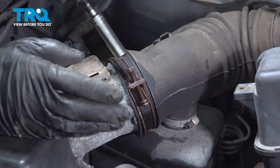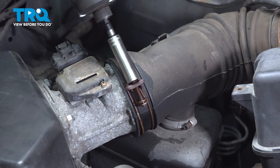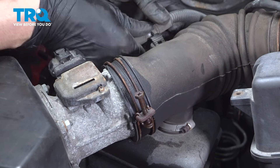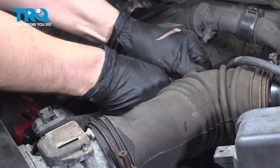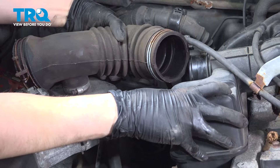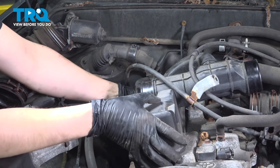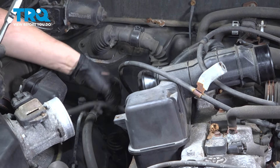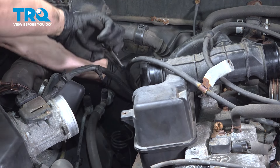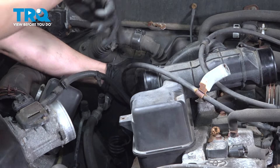In order to make a little bit of extra space, you can take this clamp off so you can pull the whole thing off at once. You may not have to, but I prefer to do this. Loosen it up, get this wire popped off of here. There's another similar retainer in the back here, then we can remove this. Now take this off of here and continue pulling this off. Back here, this wire clips on with one of these clips, and it's easiest if you pinch it and push it through. It's pretty difficult to see, but you can also use a trim tool to pry it out of the way.